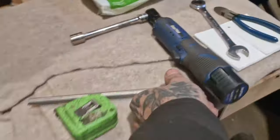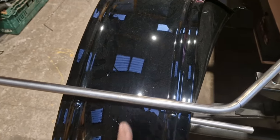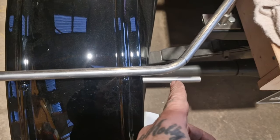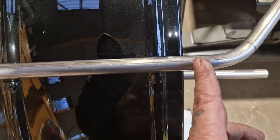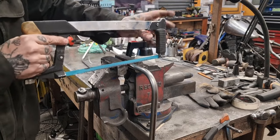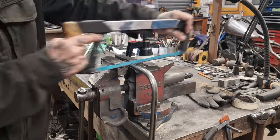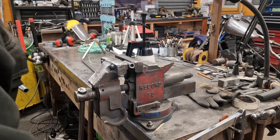So this bit of half-inch solid sits in a holding fixture underneath the guard. It's going to be really hard to film, so bear with me. I've measured down - an inch and three quarters - to get this in line with that. When I hold it in proper place, these all line up. So I'm going to chop an inch and three quarters off that end, and cut it shy of the mudguard. I've not got enough of this to hold in the bandsaw easily, so I'll put it in the vice and use my hacksaw. I really enjoy using my hacksaw - it'll make short work of this tube. Just go nice and steady and then we're away.